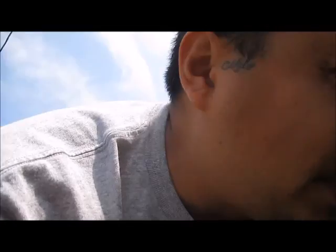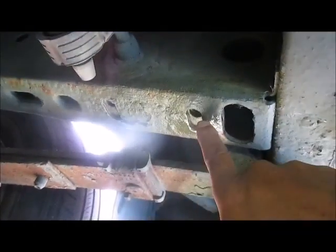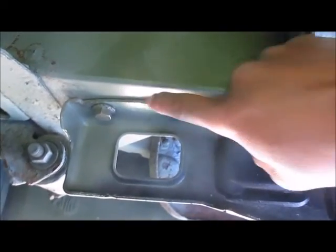Let me show you where I was talking about on the bolts versus the e-trailer. This thing is heavy — it's going to be a feat getting this up by myself. Now we're under the van. These are the two factory bolts I got to remove that the bumper bracket goes to. The e-trailer ones and other ones require you to unscrew these, but this hitch doesn't bolt on those. This actually utilizes this one here, this one here, and these front two. They look wet — what I did earlier this morning was come in with PB Blast and sprayed it in between these holes to hopefully get them to loosen up. Now these on the 2002 Astrovan are 15 millimeters, but the ones that came with the hitch are 17 millimeters.